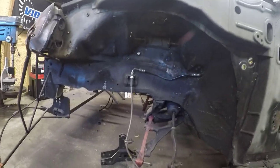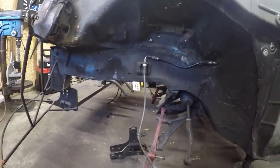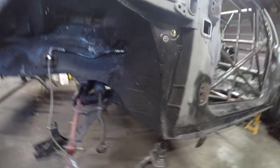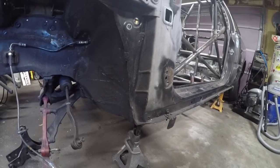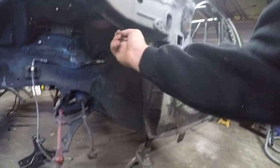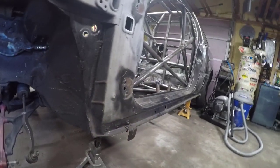There are a couple of different places I want to make a little bit more room. Not that my tires were getting cut at all, but you can obviously see a couple of spots where when we're turning hard and hitting bumps that it was happening. I don't want anything to compromise the tires, because if your tires go, you go. A big thing is definitely this pinch weld — that's just a sharp edge. I've beat it over and stuff, but that's not all the way right. I want this to be legit.